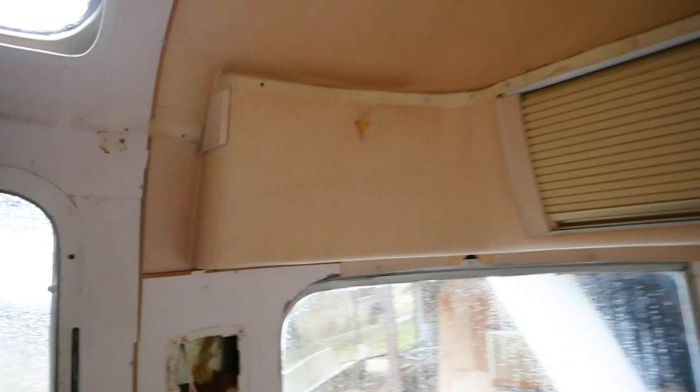Back here, I've got a few drips coming from the ceiling, which I think is super weird. It's not coming from where this vent pipe went through or where the vent is. It's just coming out from this aluminum track. You can see water right there. That seems like it's probably leaking through the seams in the aluminum from the exterior, which doesn't seem like it should be happening. Also have a leak down here, leaking on that old speaker coming through on this window.